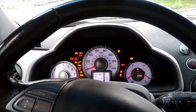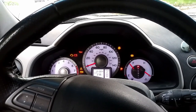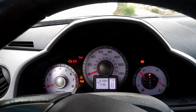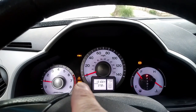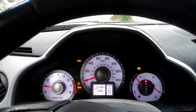I'm going to show you what happens when I turn the ignition — not starting the car — I get lots of regular lights and that's all well and good. I'll buckle my seatbelt here so you can see that the seatbelt light goes off. And then when I start the car, you can see the problem is the VTM4 light, the exclamation point, the VSA light, and the ABS light.